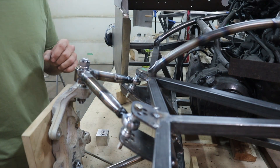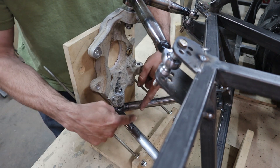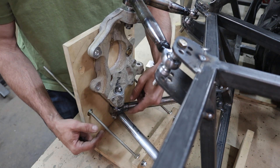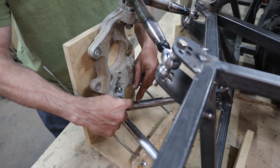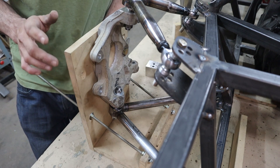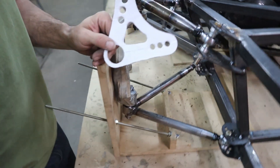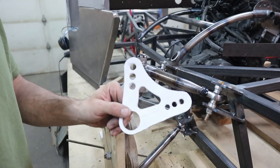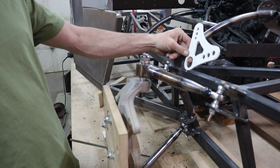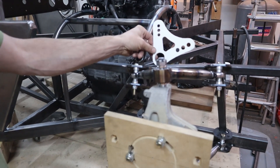For the bottom of the push rod I've got a piece of plate that goes on here — a small one — as well as a small vertical one that it will sandwich between them underneath, and then two tabs coming up for the heim and the push rod. The push rods have multiple mounting options to allow me to adjust my spring rates.